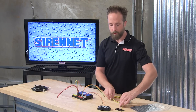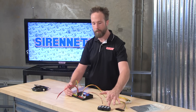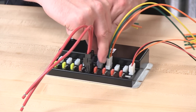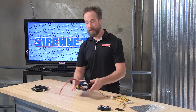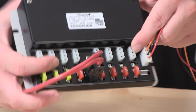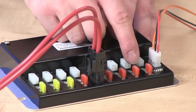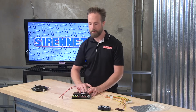As you can see, it's very straightforward. If you need to disconnect anything or rearrange it on the PCC-8R for the button array — what button you want to control what accessory — all you have to do is remove the harness input and switch it over to a different input post. A nice feature of the PCC-8R is that below the inputs, above the fuses, there is a diode that acts as an error indicator. So if the PCC-8R or any products tied to it are having issues with functionality, you'll get an error indicator flashing.